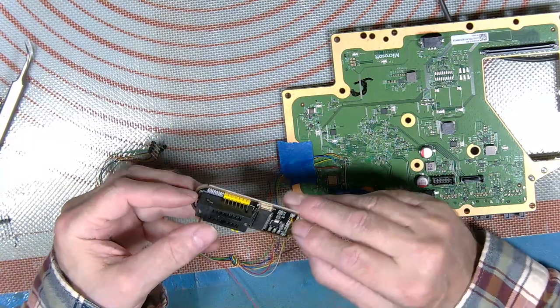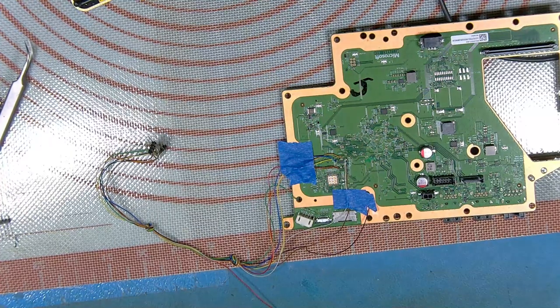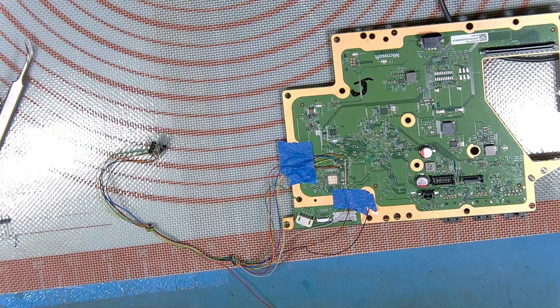We don't use a supply. I'll tell you what, I've got one that's modified because, as you know, there's a mod for them to convert into 3 volt or 3.3 on the signal. As they come standard, they're 5 volt, which could possibly damage a NOR that's only running up to sort of 3 volt. The mod for these, it's all over the place.